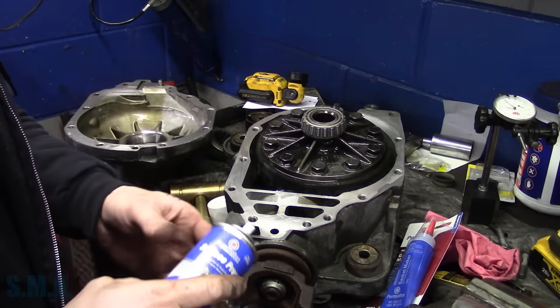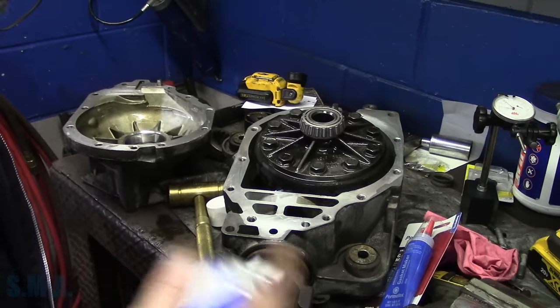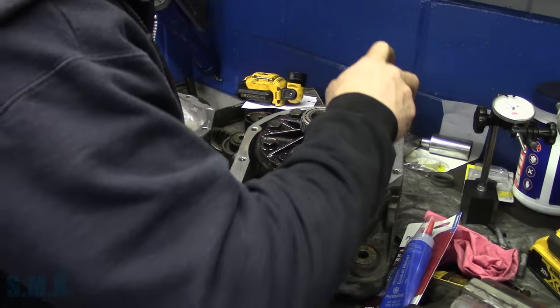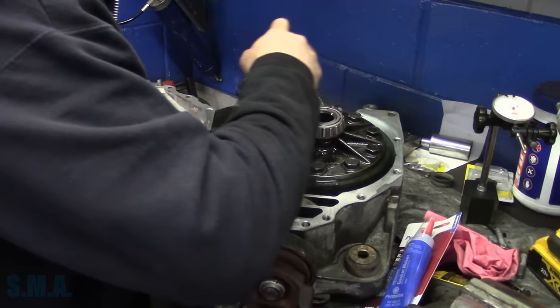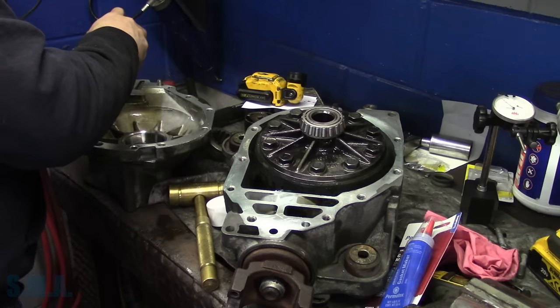Once you have both case halves clean, get yourself some Permatex Surface Prep, not a sponsor. You always gotta get a new can because you can never find your old can. And if you do, the aerosol's gone on it anyway, so just get a new can. Spray that on both halves. Like I said, make sure they're clean and dry.